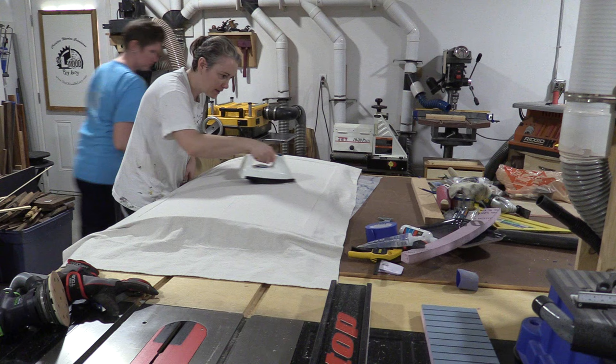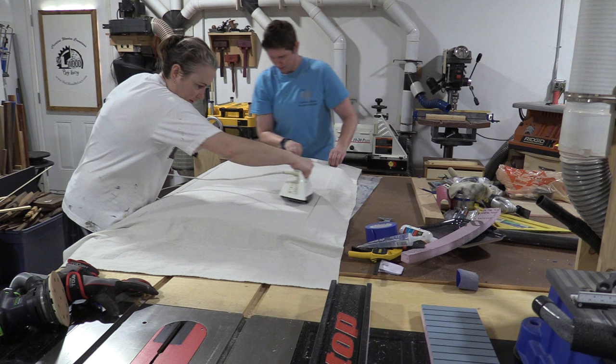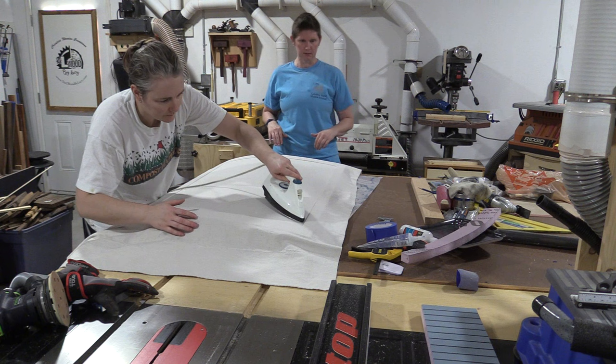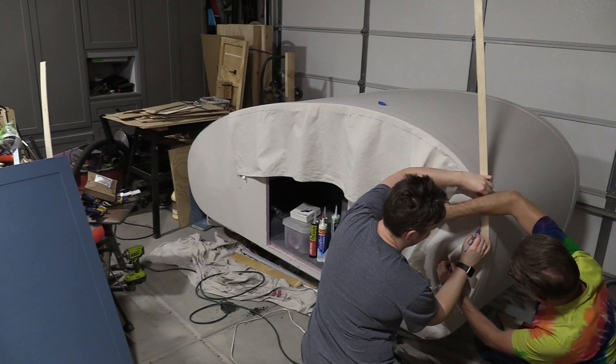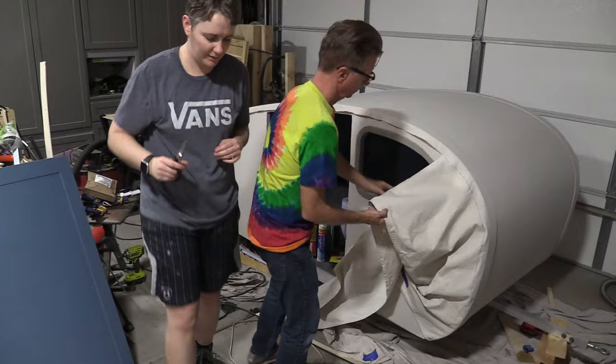For the ironing step, I'm going to jump over to the clip on the hatch, because hopefully you can see a little bit better how I'm going to really try to work that iron into the edges of the trim and into the corners. You just want to make sure that you get that well adhered, so when you're placing the canvas on, you want to allow enough material — don't be pulling and stretching on it. This trailer has a grid that's going to go over it on the outside, so I cut a spacer block just to be the same width as the grid, and I'm just going to mark out where we need to cut the canvas. As we round the corner, it's very important that we're pulling the fabric to keep it perpendicular to the edge, and this is going to be really important as we glue and iron this down as well. When you're cutting this, you just want to use really sharp scissors because you want to avoid extra strings or fraying the fabric.